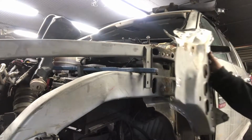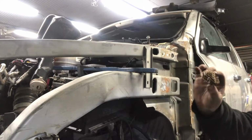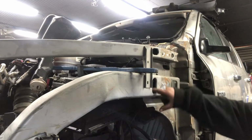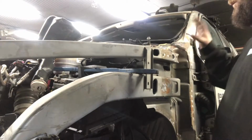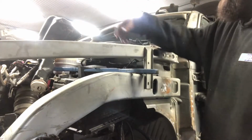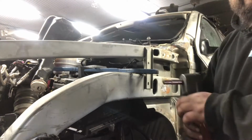And just like that, this piece came off, revealing a really nice hornet's nest. So this piece comes off, to the trash and go. Now I just gotta do the same thing for 4 spot welds here, 2 spot welds here, 2 here, 1 here, and take this apron off. So I got all the spot welds sanded down or taken off. Now I just got to take a couple of ground wires off the apron, and the apron should come off with a couple of hefty hits.